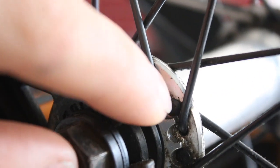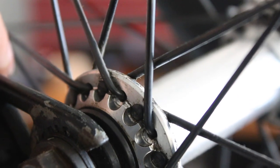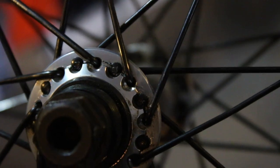So the main issue is the front hub. I first noticed that it had a bit of a buckle, and then I noticed that the flange on the front hub looked a little bit wobbly. After closer inspection, I noticed a crack — you should be able to hopefully see it here. It crosses about five to six of the spoke holes. No idea how long it's been like that.